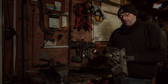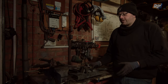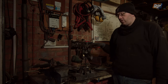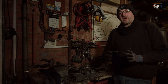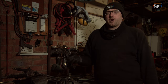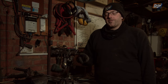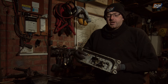There are definitely ways we could fix this with either an aftermarket shifter, which is expensive, or modifying this much more than I'm comfortable with. So before we resign ourselves to running extremely long cables out of the front, I want to try to find a way to use this shifter with shorter cables — maybe even the existing ones — running out the back of this unit, in through the front of the engine bay, underneath the firewall, and up into the front of the gearbox. This episode is all about turning this into something we can hopefully fit onto the car and how we get around the limits of this mechanism.